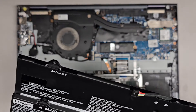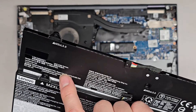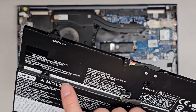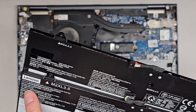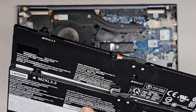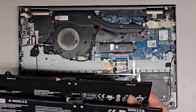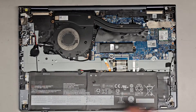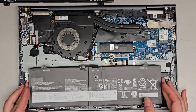Capacity: 4622 milliamp hours. The new one has a little bit higher milliamp hours — 71 watt hours — this one is only 68.7. The voltage: 15.36, also 15.36 volts. So this new battery should actually have better capacity. It does look to be the same everything else, so that's nice. We actually got a battery upgrade — slightly higher capacity.